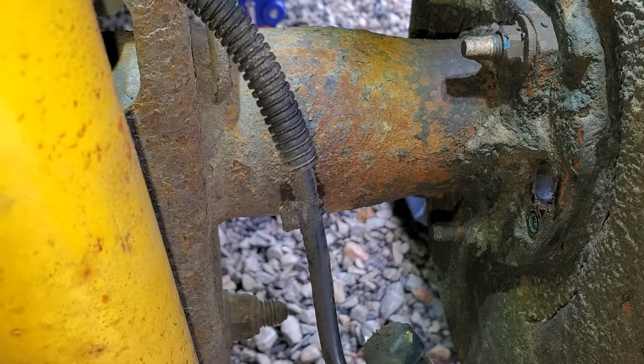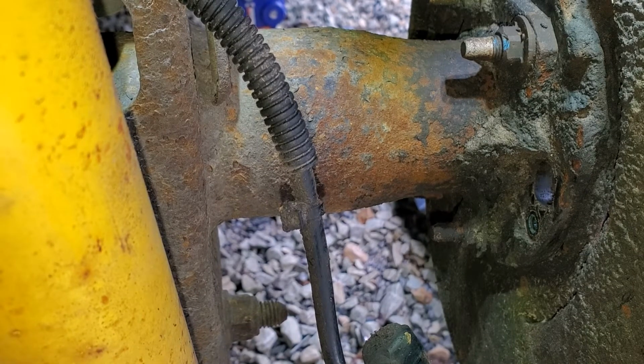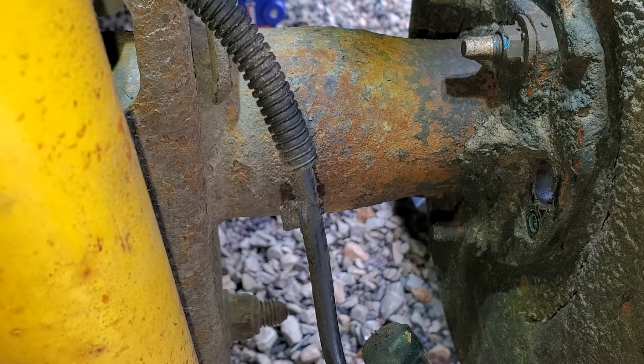Well, I guess we'll visit that whenever we get there, but now we're gonna break open a differential and drain the fluid out of it. One thing I will tell you is before you take the differential rear cover off and drain that fluid, make certain that you can break loose and remove the fill plug. It's a magnetic plug that uses either just a 1/2-inch drive or a 3/8 drive with no socket, just the ratchet. Be real careful you don't round that thing off, or you'll be in serious trouble. But if you can't get that fill plug out, don't even take that cover off, because without being able to fill it through there, you will be in a really bad situation.